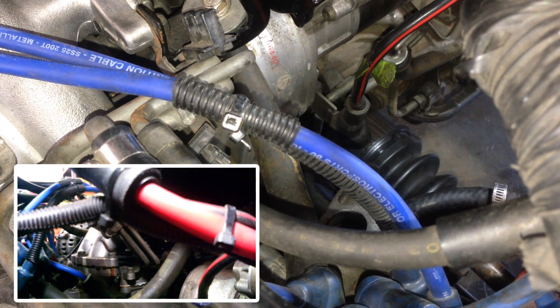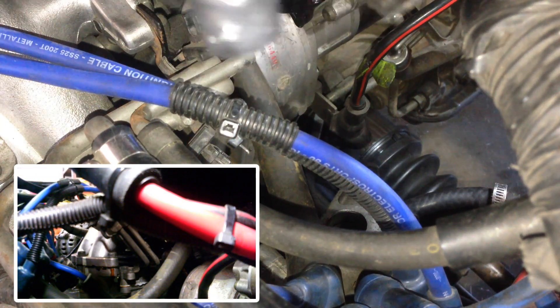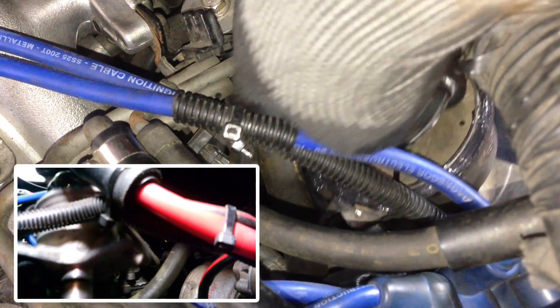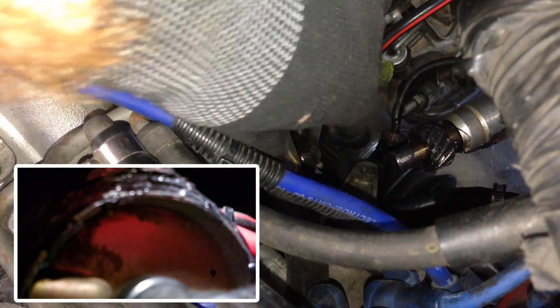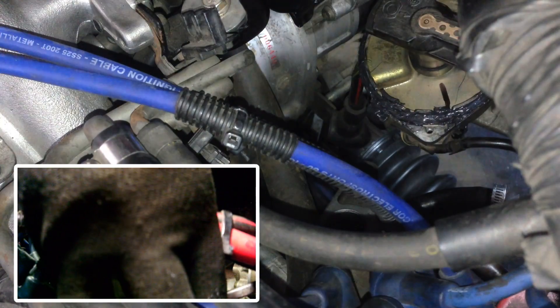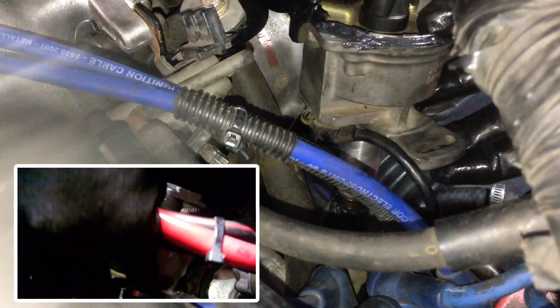So now it's just a matter of putting our new distributor in. What I've done is I've put some grease on the gear, put some grease on the spigot so that when it first turns it's not dry, and a bit of grease around the o-ring — and it's ready to go in. Remember we marked the old distributor first, so it'll match where that mark was on this new one, and that'll help us phase the rotor properly — good enough to start so we don't have to turn the engine at all.